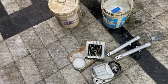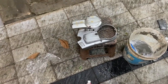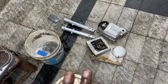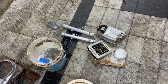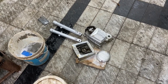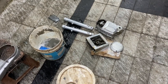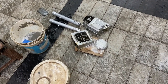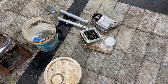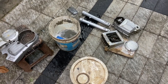Everything is sanded now — basically it is ready for the final sanding. The forks actually have two or three places where we need to put some spot putty, which I'm going to do. After that, we are going to let it cure for almost 20 minutes, sand it properly, and then finish it for paint. From the looks of it, I think this is achievable in today's video.